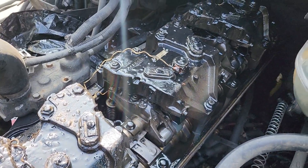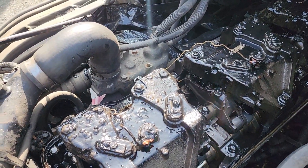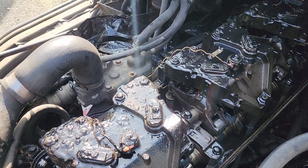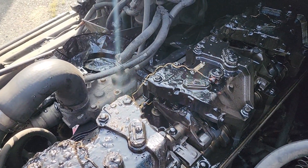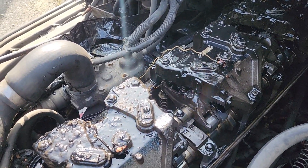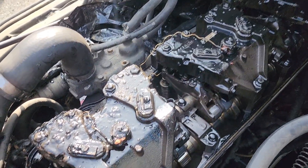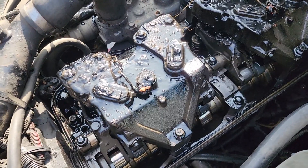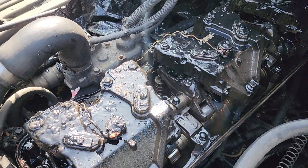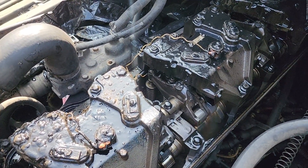It all has to come off and I don't know what to expect. I did a check with the computer and the number two cylinder was the one making the steam miss. When I disabled number two it no longer did that and the engine was running without puffing steam. I'm almost 100% sure the number two cylinder has sunk in the block — hopefully it did not sink too deep.